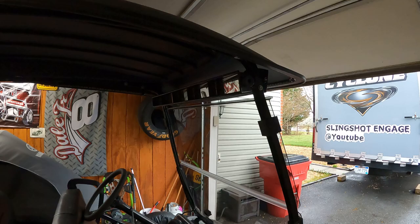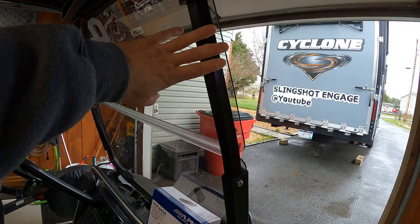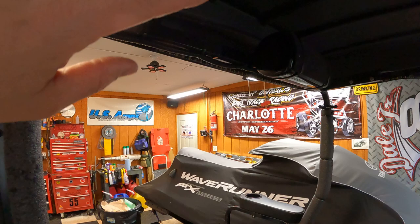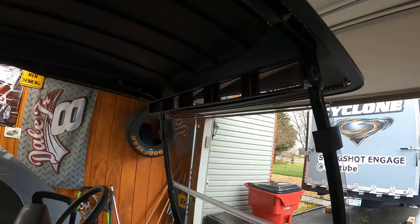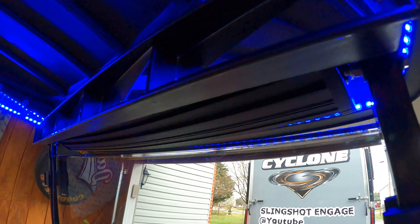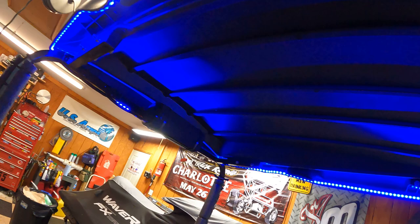The roof — this golf cart did not come with a roof. I had to buy the front support which cost about $180 shipped on eBay. I had the rear lollipops, and my buddy had to weld me a piece of square tube back here to accommodate the roof. It is super sturdy and super squeaky. For some interior lighting, I used cheap Amazon strip lights, but if you have a hard corner to go around you're probably going to need a hot glue gun.